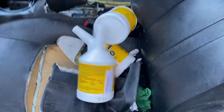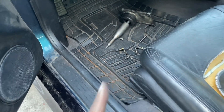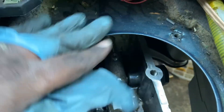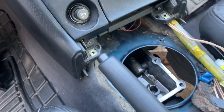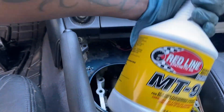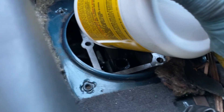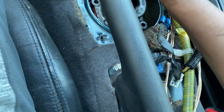I've got a couple more things to do — put the fluid inside the trans, put the shifter on, and tighten two more trans bolts. Something I do when I pour the fluid in is pour it from the top. You don't want to get a lot on the outside — aim for that hole right there. Something I like to do is jack the car from the back so it tilts, that way the trans fluid drips forward into the gears. It works — no grinding or anything. This stuff is magic, so as long as it's in there with the gears you're chilling. As you can see it's dripping towards the front — that's what you want.